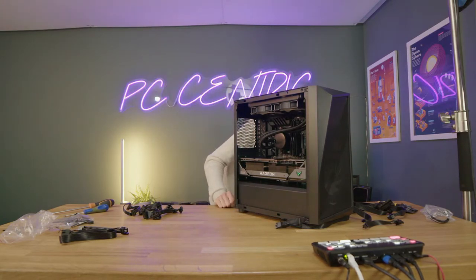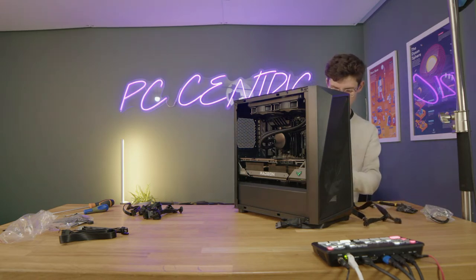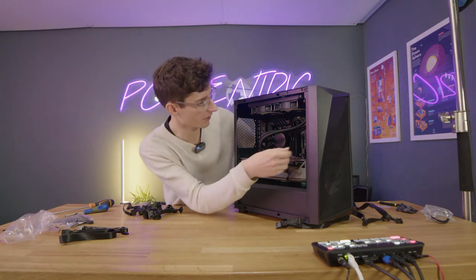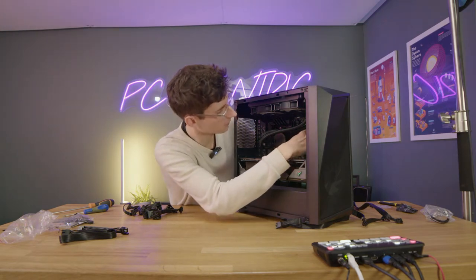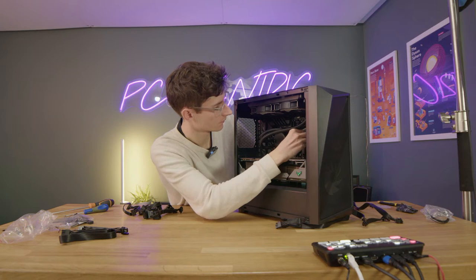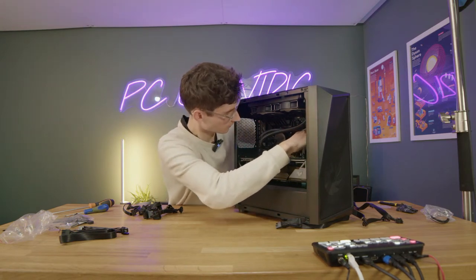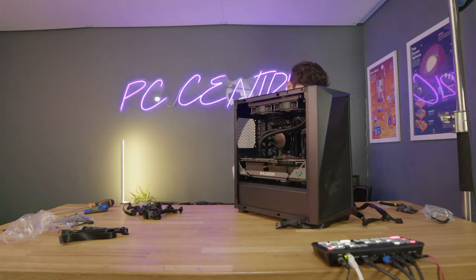Yeah, I'll just double check the motherboard. The one they said, B650 Aorus Pro AX. It's got an 8-pin and a 4-pin. So it could deliver, but I still wouldn't trust it. It's on the limit there, isn't it, really? Yeah, I wouldn't do that. For that sort of price, I think you're not far. It's $329 for the B650 Aorus Pro AX anyway. So you're really not far off